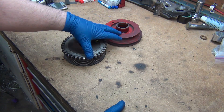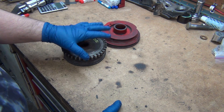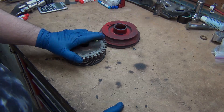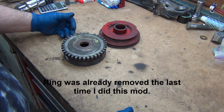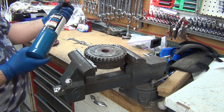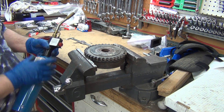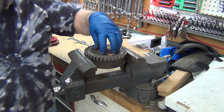I did it before as a heat-and-shrink — basically an interference fit — where the ring had to get heated up and dropped on. But this guy wants it to be just a slip fit so he can tack weld it. I need to do a little checking because I'm not sure that's the best option. First I've got to figure out how to get the ring off; I'm going to heat it up and see if it comes off, or maybe try to press it off with a gear puller.